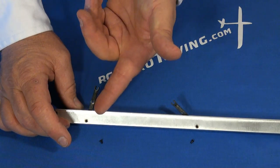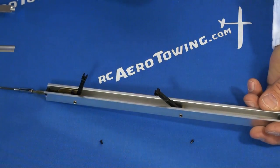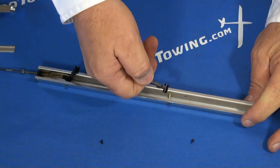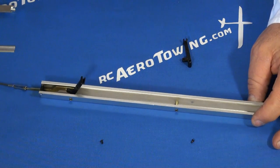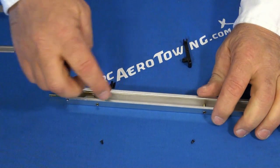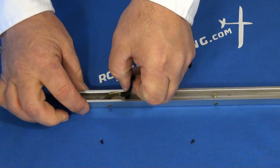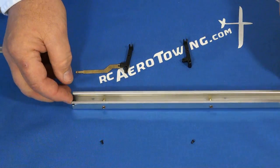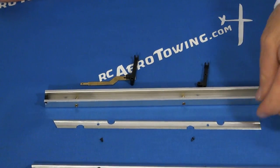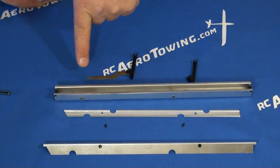Now we have left the mechanism and the two pivot arms. The pivot arms are attached to a metal rivet that goes to the bottom side. By putting your thumb on the forward, non-open side and clicking it forward, you can get it to release — noting the orientation as you take it apart. Do the same on the front side; you'll need to take the clevis off first. With a little wiggling and controlled pressure, you can take this pin off too. Now you have all the parts of the spoiler taken apart to be cleaned, lubricated, or straightened — always keeping track of the orientation of the parts.